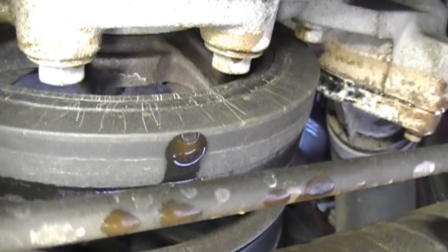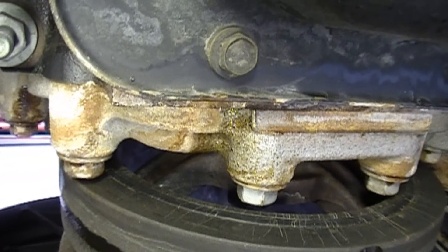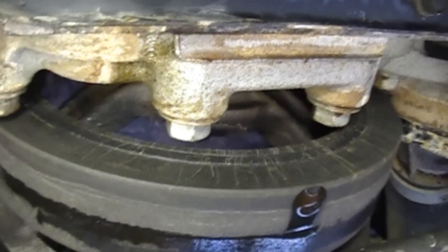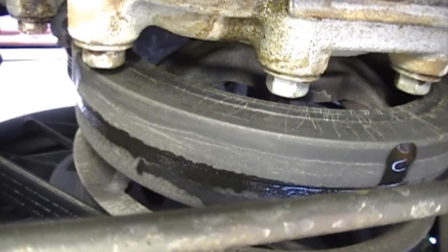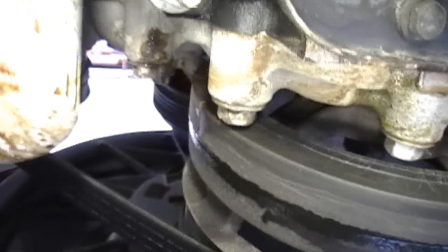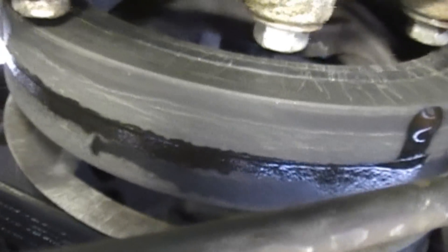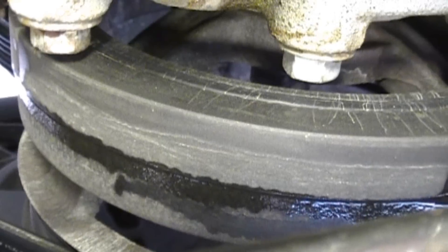I had to add a little coolant about a week ago — about a quart — and I was kind of nervous about it. I figured something was up but didn't have time to deal with it, so I've been watching the coolant level very carefully as I drive. The water pump sits directly above where that leak is and has been distributing coolant around the harmonic balancer. So the diagnosis is pretty much confirmed: it is water pump time.